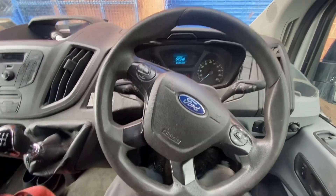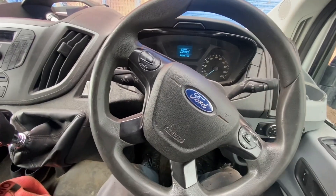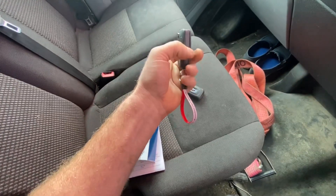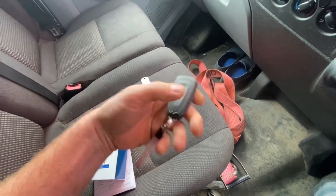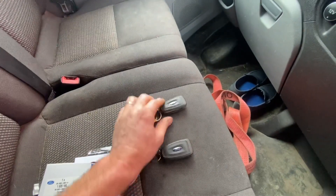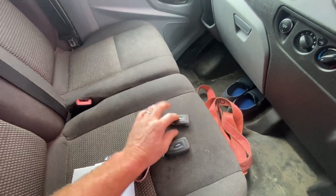It's the next day and I'm back on this Ford Transit. We have Alan from Keyfast - actually on this occasion it wasn't Alan, he's out in Croatia, so it was another chap called Nikki. I touched base with Nikki and said we wanted another key set up. Here is the new key that he has cloned. He actually said he didn't think there was too much wrong with the old key other than the battery going flat, and that the car should start anyway from the aerial waking up the chip inside it.